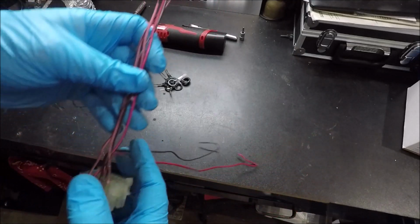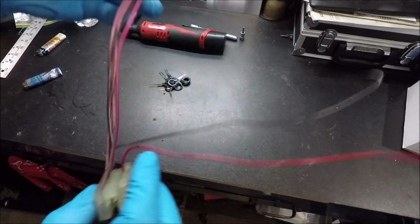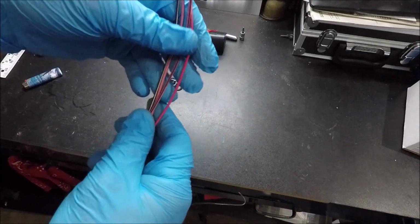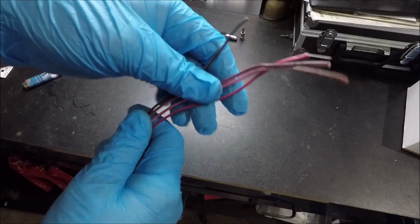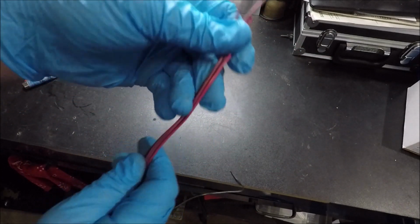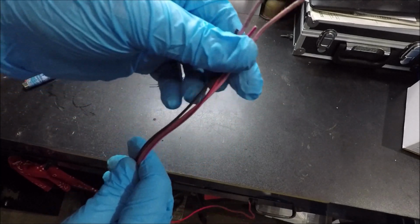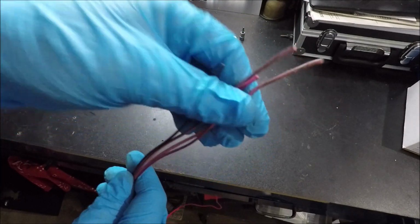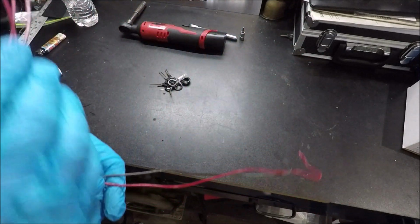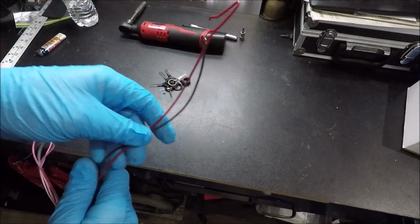Okay, so I went ahead and got this figured out. I pulled pretty much everything out. These are the only wires I kept out of the C207 harness. All of these wires have 12 volts with the ignition key forward. I did not check yet to see which ones had 12 volts while cranking, because I'm going to need one of those to energize the Holley ECU.